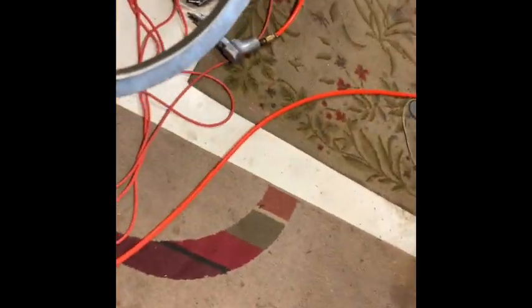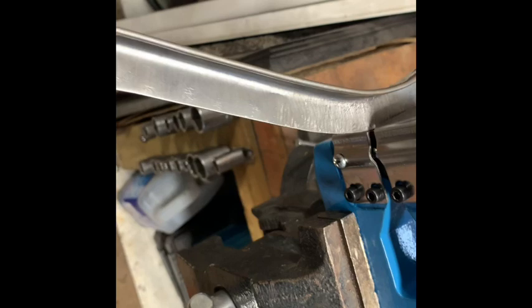And see, I've made my first bit in my shrinker. So I bent the edge of a piece of metal and I folded it over so that I don't have a sharp edge, like when you put your hand on the edge of the trunk or something. And then I put it in my stretcher and I get the shape I need. For this one, I needed the stretcher. So I'll put that underneath the lip and I'll cut this out at the end and I'll weld it in.